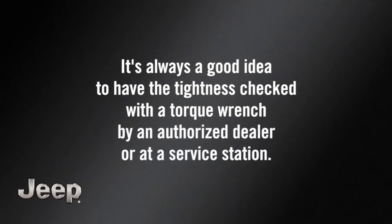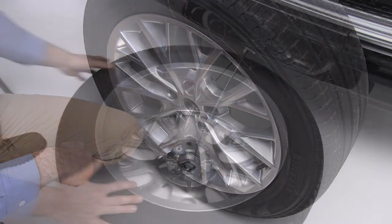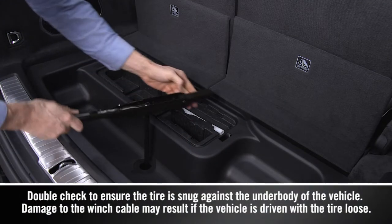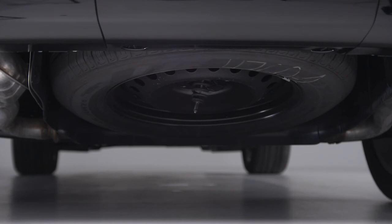To secure the damaged tire, position the wheel behind the rear bumper facing outward. Then, push the end of the winch's cable, spring, and steel sleeve through the hole. Slide the road wheel on the ground until it is directly under the winch. Raise the tire by turning the lug wrench on the winch extension clockwise until it clicks 3 times to make sure the cable is tight.